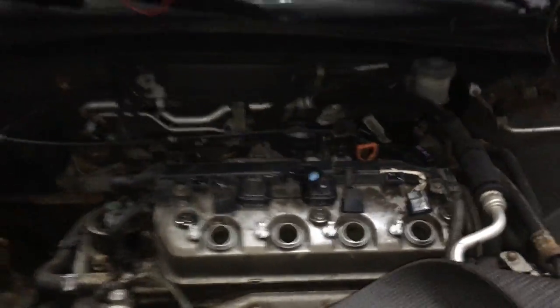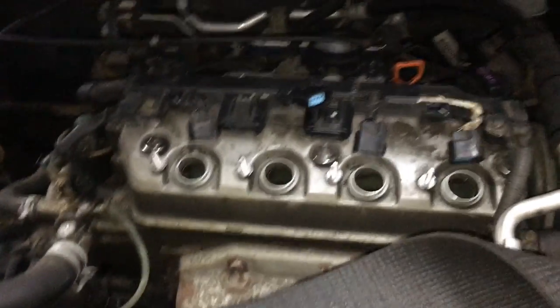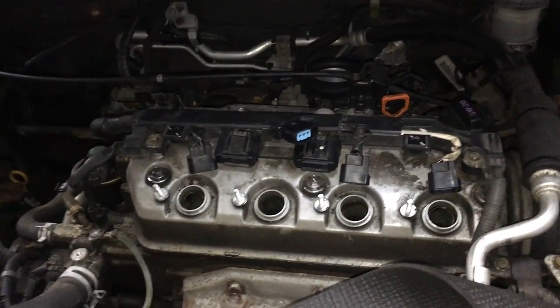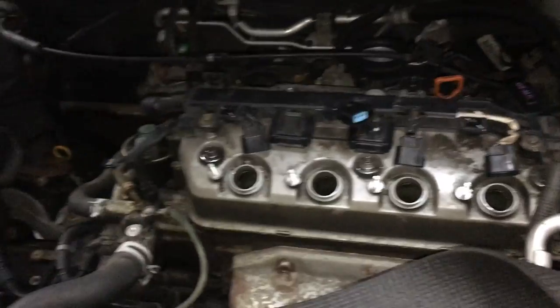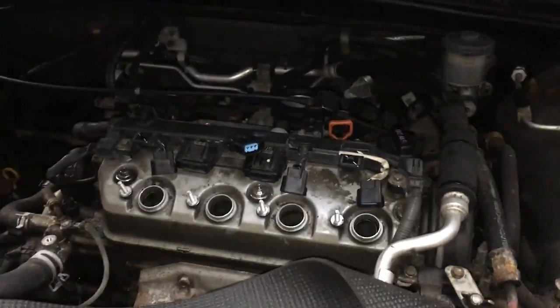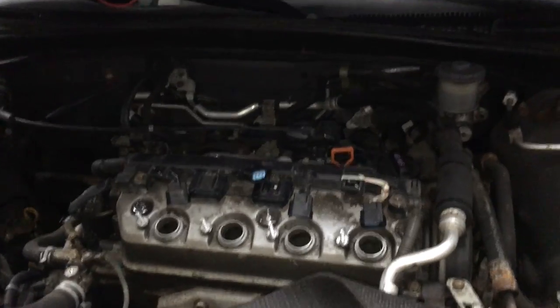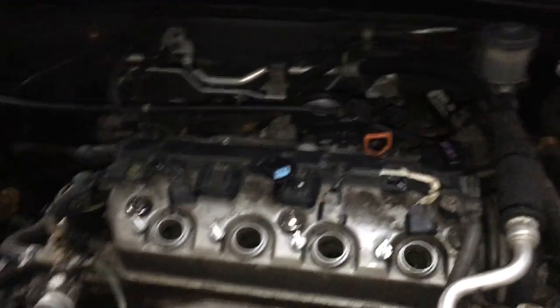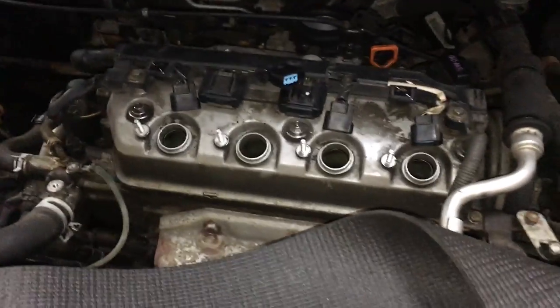We proved it in this video — we had 180 PSI on the cylinder and we put roughly 30 to 40 pounds of air into the cylinder and showed the customer this exact video of the water bubbling out. I told them we're replicating your engine running on a one-sixth scale. We're only putting 40 pounds of pressure — now picture how much pressure and how many bubbles would be coming out when your engine is running normally. That's a good way to look at it. We probably sold the job — she wants me to get a price.